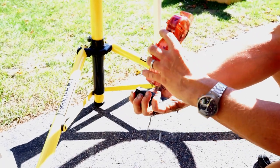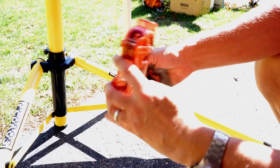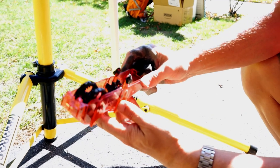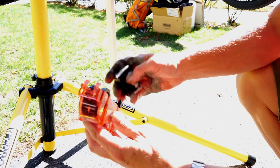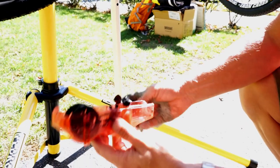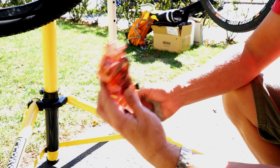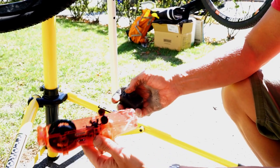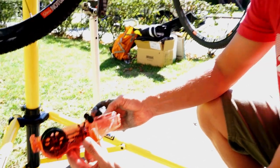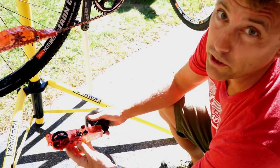Many people will often say, are you worried that based on the type of lubricant that you're putting something bad into the earth? What I tell people is, if you lubed your chain properly, the dirt that's mostly coming out of my hand is dirt. It's been attracted to the light oil or other things, your wax lubes, that's been sitting on the chain. So most of what's coming off is actually the combination of the degreaser, which is biodegradable, plus the dirt. People, again, often worry about biodegradability of the oils that are on the chains. But at this point, with how dirty this chain was, it's mostly dirt.